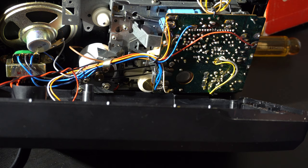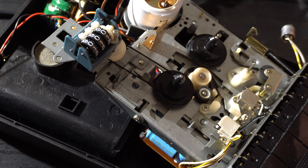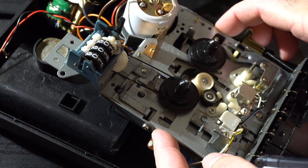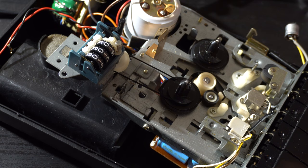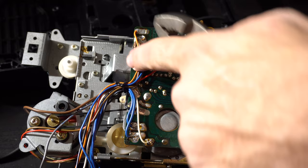I did manage to get the eject working again by jostling the box a little bit, and then I opened it up. Inside there was just one main belt and a counter belt, and much to my surprise, these 41-year-old rubber belts were still intact — so it's not the belts. With a little prodding I got fast forward to turn a little bit, but I never could get it to play, and it continued to make some weird spooky noises. That seems like kind of a cheap design.